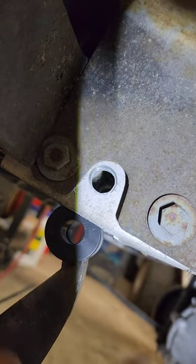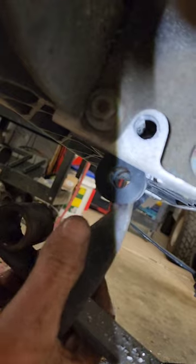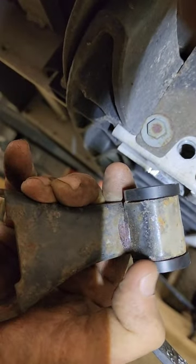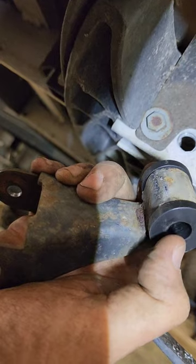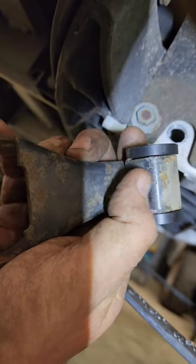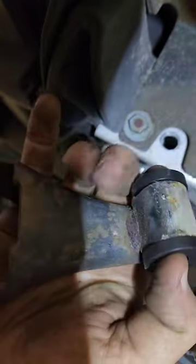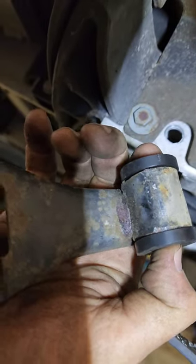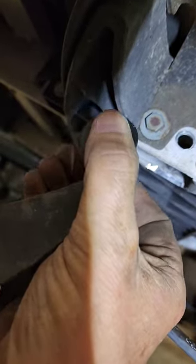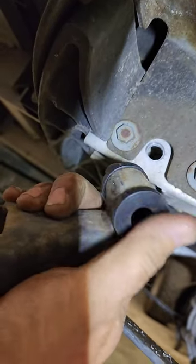We're on the rear — the rear part of the rear leaf spring right where the shackle is. We've got our new bushings installed. These have a thicker shoulder but shorter length. The rear ones have to be a little bit shorter because of this shackle design, which offers less support in a turn. That rocking motion is what helps bust out the cheap rubber bushings they put in the springs from the factory.